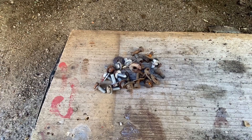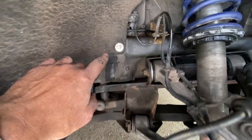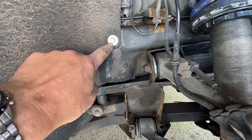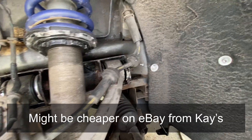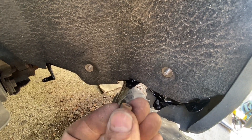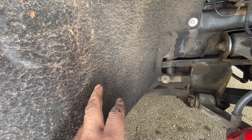There's a pile of rusty old screws that I've taken out. I bought most of mine from Toolstation — they've got M6 by 16mm bolts that are direct replacements, about £2.29 for 10. They had washers for about £7 for 50 of them. I ran out of those bolts so I've used allen key bolts like the originals, actually identical to the originals, but mine won't rust and go manky. So that's all bolted in with stainless steel. I drilled an 8mm plug hole in the front of that box — it's stainless steel so I could just drill straight into it — and the plate I welded in is stainless steel. The bracket's done, we're all good.